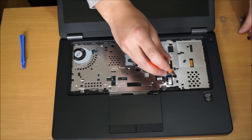So here you go, after I clean the heatsink, a lot more clean. Here's the thermal paste I'm using, Noctua NT-H1. This costs $10, so don't be cheap on it. Since there's two areas on the CPU we need to apply thermal paste on, on the smaller one, put half a rice grain, and on the bigger one, put a one rice grain size of thermal paste.